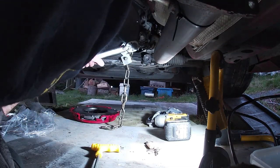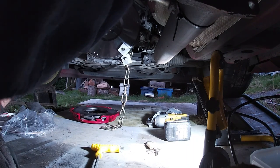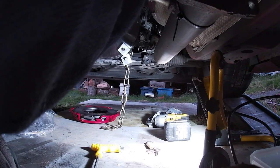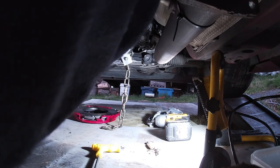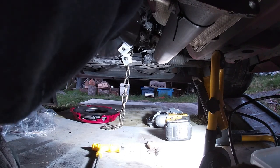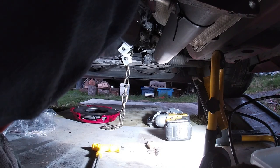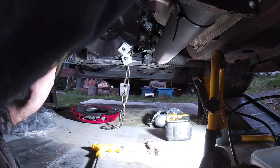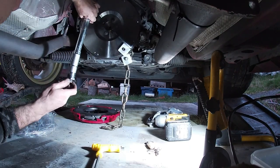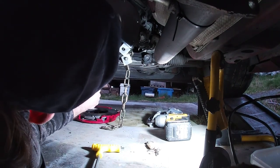Go ahead and crank that up to 74 then. I'll go 76 just because I can. So that'll be 40, 50, 60, don't use your torque wrench as a hammer as I have, it's a bit tight this one, 70, 76, which ain't coming loose. I've had one come loose before and I thought I had run a bearing or something horrible. It's just the flywheel loose.